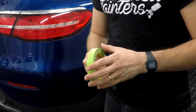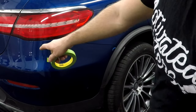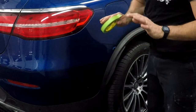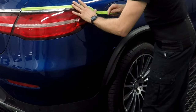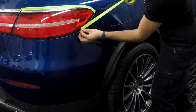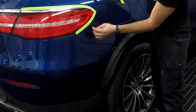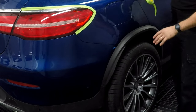The first thing I'm going to do is tape up some of these edges here, just to minimize as much overspray as I can. You don't have to go crazy, but basically what you want to do is cover up this gap, because if you don't, you're going to get overspray on this — 100% guaranteed.